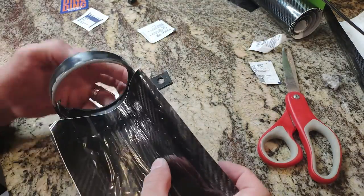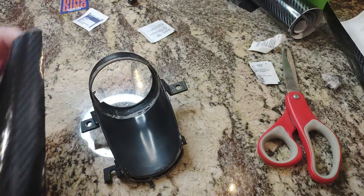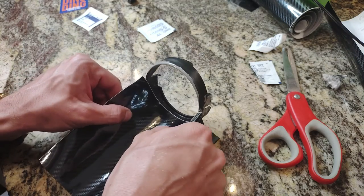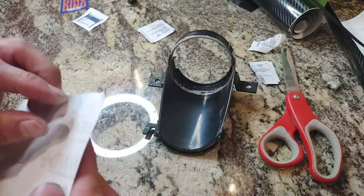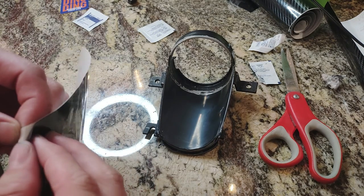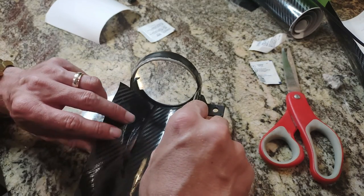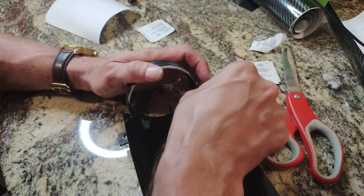This is just some gloss carbon fiber 3M vinyl I got off Amazon — I'll put a link in the description. I figured if I'm going to use any real carbon fiber at any time in the interior, I might as well use the gloss so it'll match a little better. Now I'm just heating it up with a heat gun — an inexpensive heat gun you can get from Harbor Freight. I'll put a link in the description for that as well. I cut a piece for the general area but nothing specific because you're going to have to trim it no matter what. I warmed it up just a little bit to make it more pliable to get started. I'm just laying it in there as close to the center ring edge as I can get. I'm going to do this in two pieces — the outer ring around the vent is going to be a whole other piece.